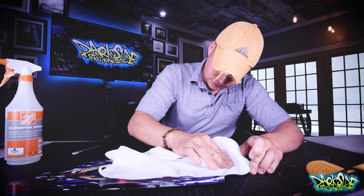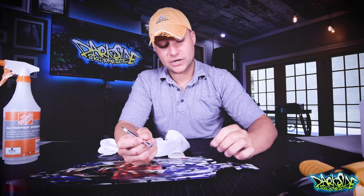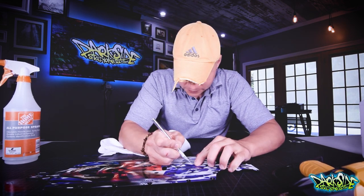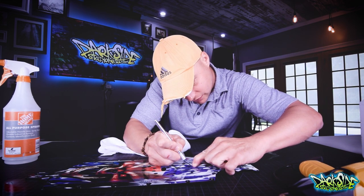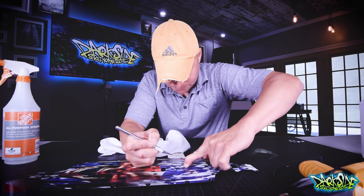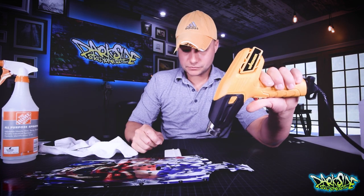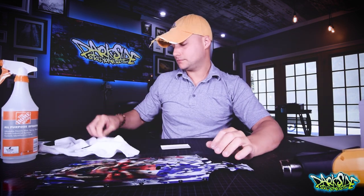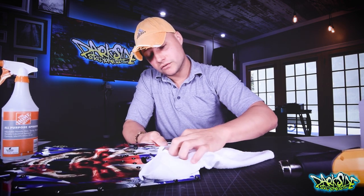You're probably going to have some air bubbles left, so we're going to need to pop them. Whenever you do a dry install it's almost impossible to get these things down without an air bubble or two. I can see one right here — I'm going to push it with my finger and pop it, lifting it up with my knife a little bit. There's one more right here; I'll get in with my knife, pop it, and keep going up this channel. Then I'll come back with the heat, and the tiny hole I made with the knife I'll heat up, use my rag, and go over it while it's warm — it'll heal and close that hole up.